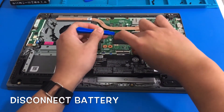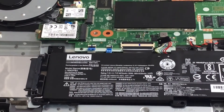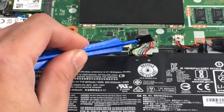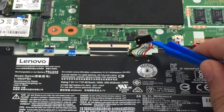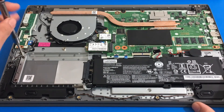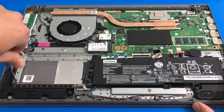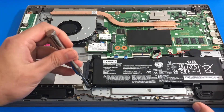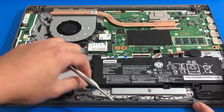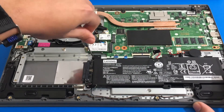Once we have the battery disconnected, I will give you a close up as well. I was just trying to grab it here, over here and on the other side until it loosened up. It is much easier now because we have done this before. Now we are going to remove the four screws for the SSD caddy. These two screws on the left are actually M2x2.8 screws — it says so on the caddy — and then we have two longer screws here on the right.